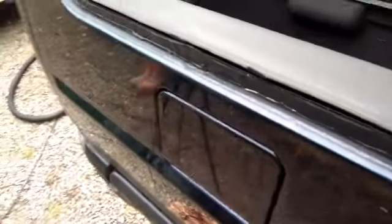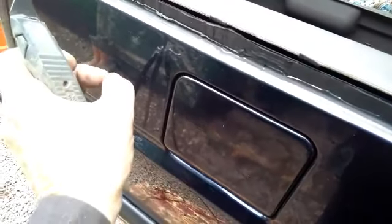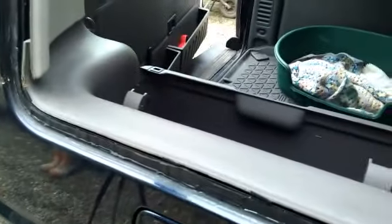As long as you don't cut away too much, no one's going to notice. It's unavoidable that you will scratch the window opening, but this is all going to be covered up by window bond. You also get a primer to prime any bare bits of metal, so it'll all be covered anyway. With that hoovered out and cleaned up - this safety glass not only breaks into lovely little diamonds, it also turns to powder and sticks to the body. You need a very wet cloth and gently wipe it all off, otherwise you'll have minute little diamond scratches all over your car.